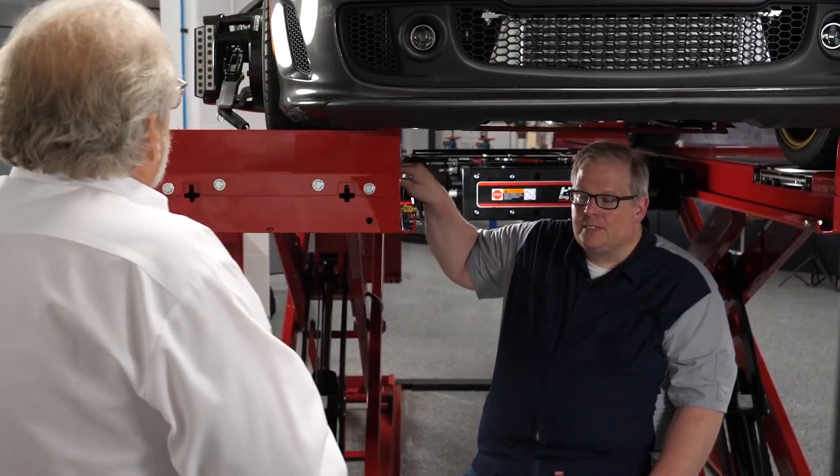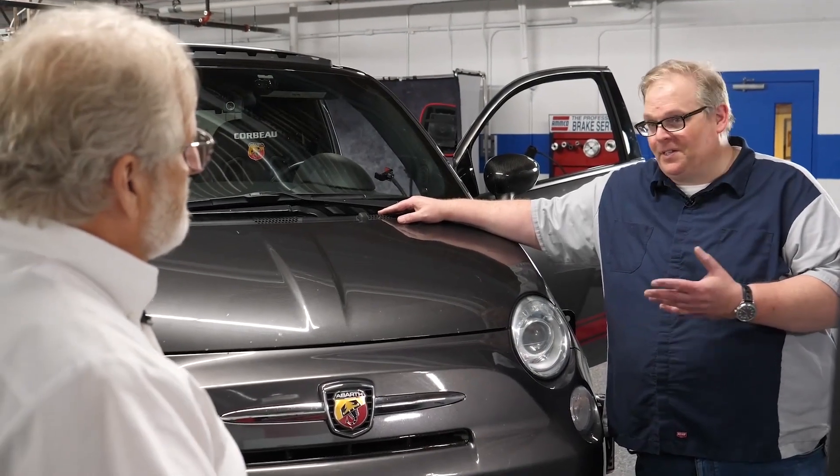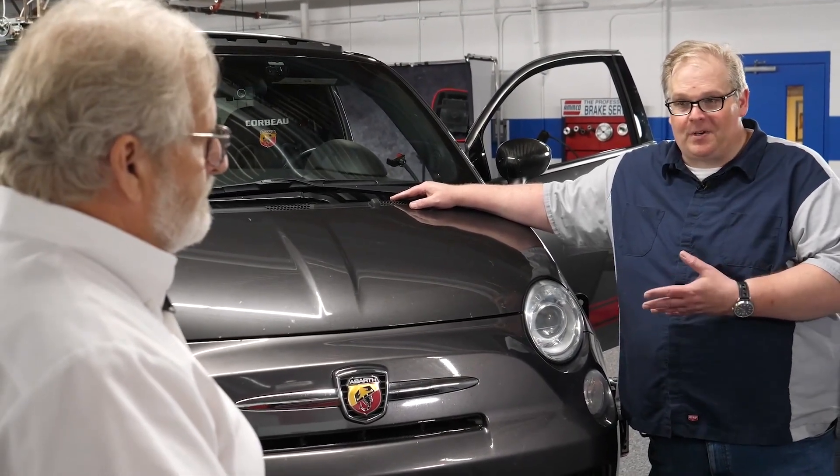When you jounce the vehicle, the lock plates should be free. When we're making measurements and adjustments to the chassis, the slip plates in the rear and the turn plates in the front are going to be unlocked. When we're rolling the vehicle during compensation, the turn plates and slip plates are going to be locked. So all the angles are in the green, the toe is set — this car is ready to ship.